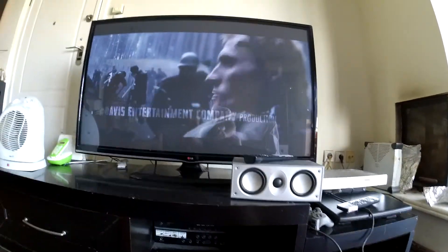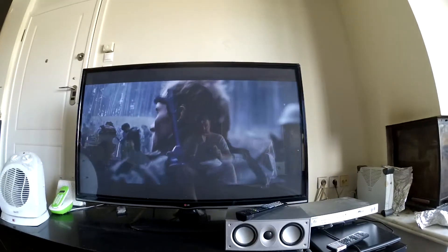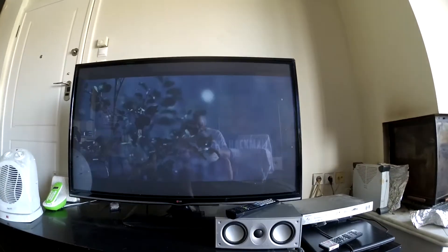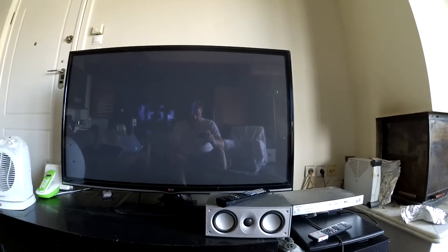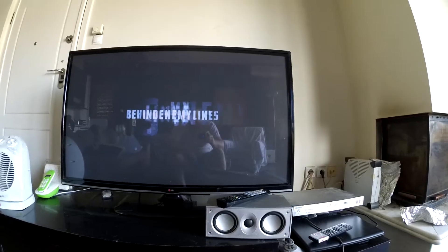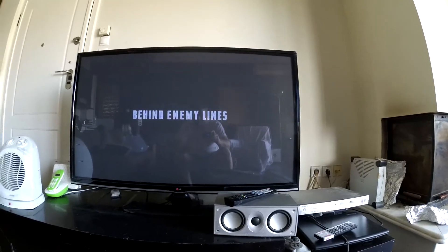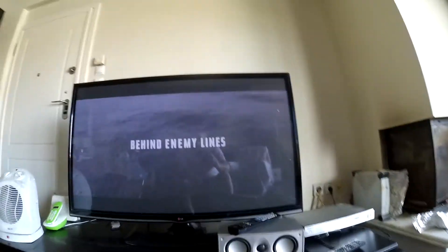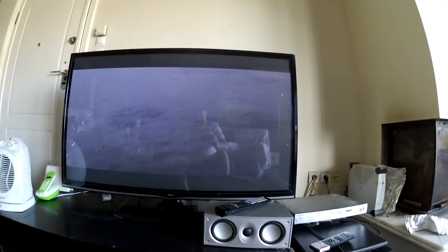The sound seems great, so that's the result. If you've got a DVD cleaner, try that first. Failing that, you can do what I did — I didn't have compressed air and I didn't have a DVD cleaning device, so I removed the case and directly cleaned the laser. We're back in business. As always, thank you for watching, subscribe to the channel, and I'll see you next time.